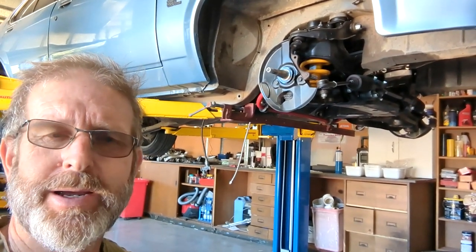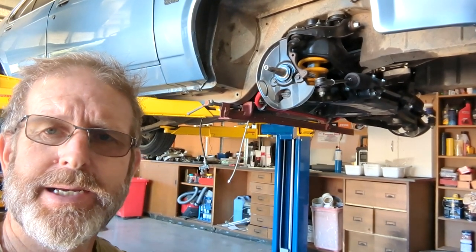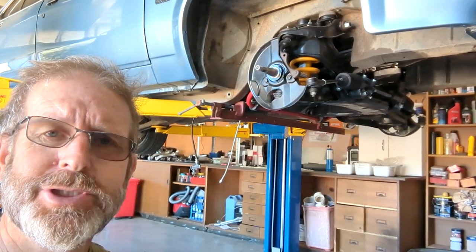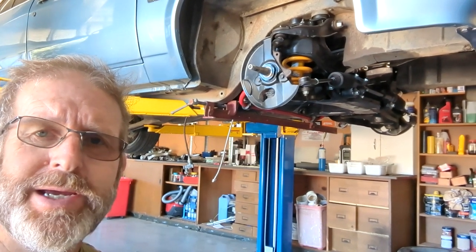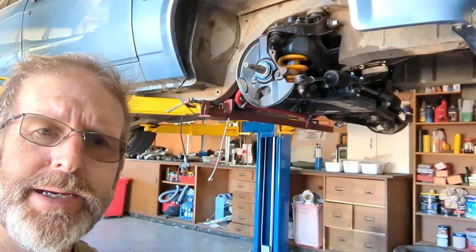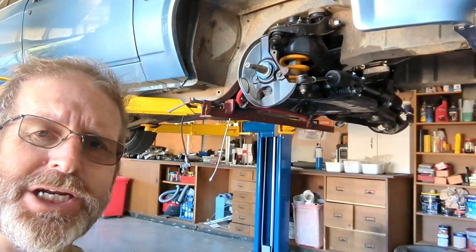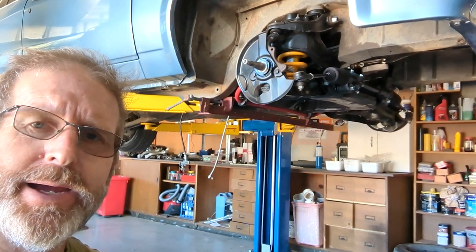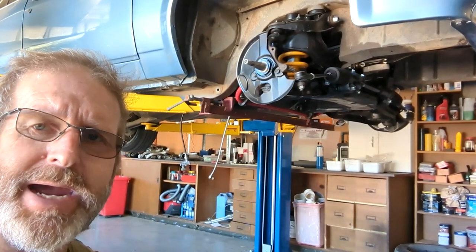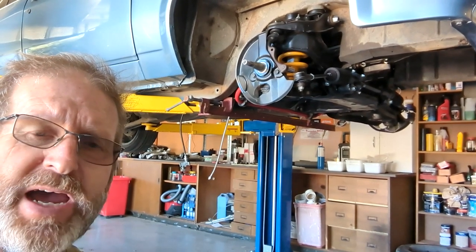That's where I'm at with the little 173. I've got to get that valve spring compressor - tomorrow's Monday, I'll go down and grab one, take those valve springs off, and check and refine what I've done on those bores. Then I'm on the path to putting the pistons back in, putting the crank back in, doing all the tensioning as I'd already done. Now that I know those valves have got clearance on the bores, it's going to make a big difference. Once I get the pistons back in, I'll do the valve-to-bore check.